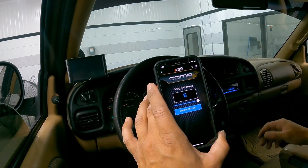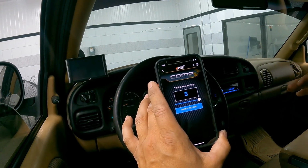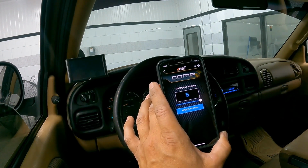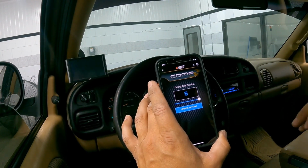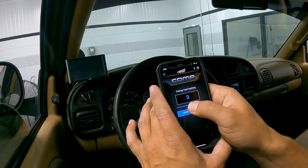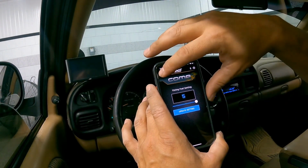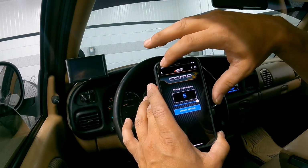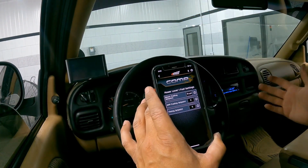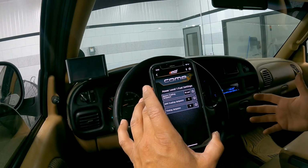That's obviously going to give you the best power potential, best fuel economy. Timing helps that stuff, but it can also hinder some applications, you know, big turbochargers. We can fine tune that timing to best suit your specific application. And there's a lot of variables that will affect this. Every truck, every elevation, whether it's an automatic or a manual, even an automatic with a different stall converter, all of that spool up, the drivability will be different on every application.